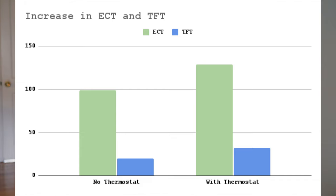In a previous episode with the Crosstrek, I mentioned installing a ScanGauge 2 OBD2 scanner to keep tabs on engine coolant temperature and CVT fluid temperature, and what I found here was pretty cool. Without the CVT fluid thermostat installed, on a crisp fall morning of around 60 degrees Fahrenheit, I took a 10-minute drive in stop-and-go traffic and the CVT fluid rose by 20 degrees while the water temperature rose by 99 degrees. After installing the thermostat on a morning just a few degrees cooler, on a similar 10-minute drive, I noticed the CVT fluid rose by 32 degrees and the water temperature rose by 129 degrees. In other words, in very similar conditions, driving with the CVT thermostat installed allowed the CVT fluid to warm up by an extra 12 degrees in 10 minutes — which was the goal all along. We did it!